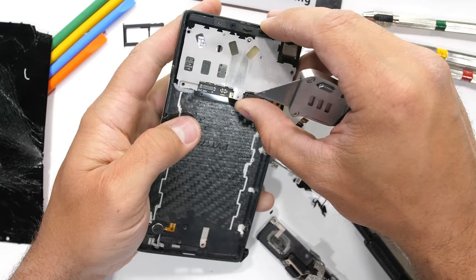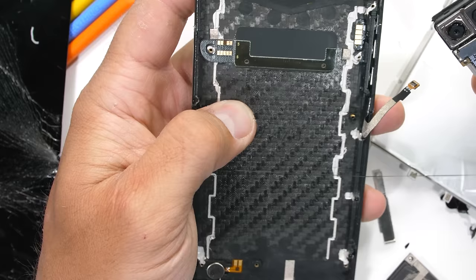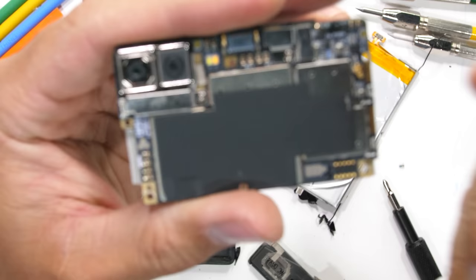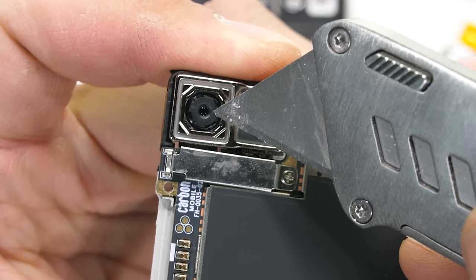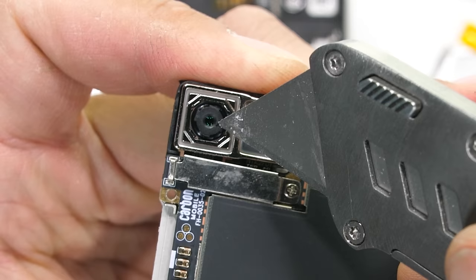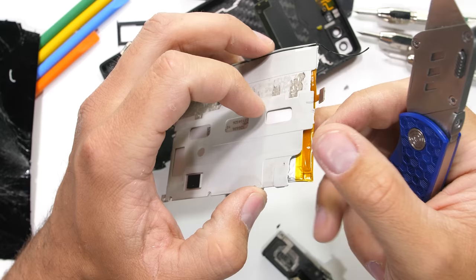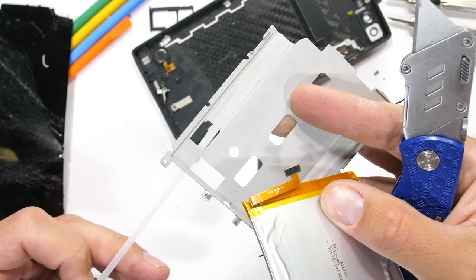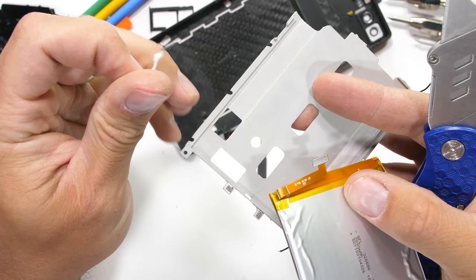The interior is unpolished since this is the stuff people don't normally see. The 16-megapixel lens on the left does have some kind of optical image stabilization, but the lens on the right does not. The battery is attached to the mid plate and has pull tabs, which would be used if someone were disassembling this phone correctly. Pulling the adhesive strip allows the battery to come free with zero bending or prying — much safer.